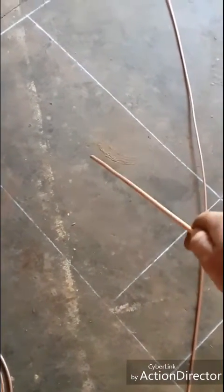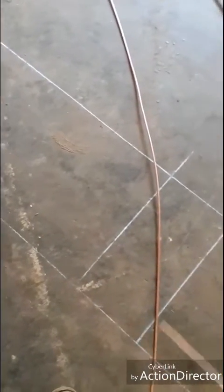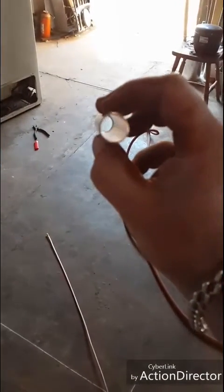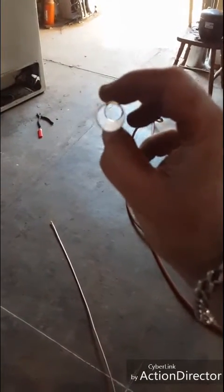We're going to do three coils at the bottom and then step up and do the outer part. Then the accumulation chamber — this is the important part. This is a half inch copper pipe. Can you see it's nice and clean? It has to be clean, this is very important. So what we're going to do is we're going to start by putting this on that end and insert this as well. This is the accumulation just for down there in the fridge.